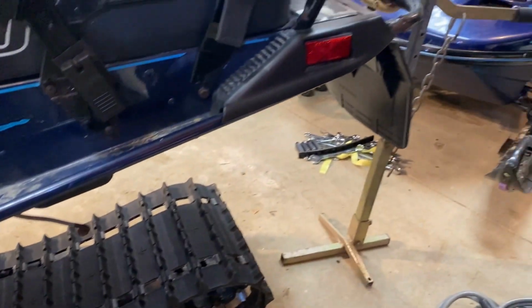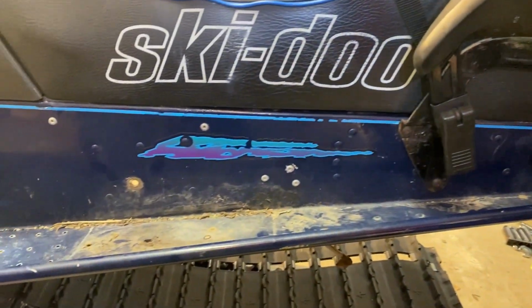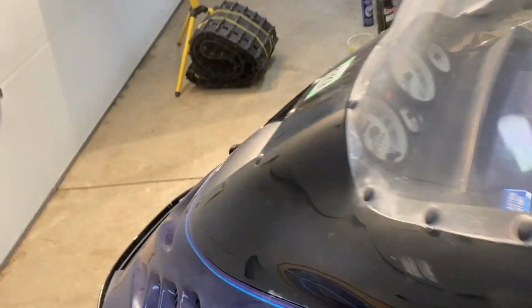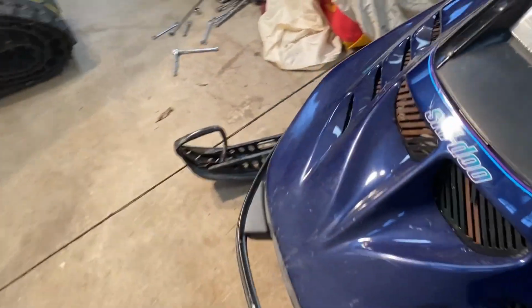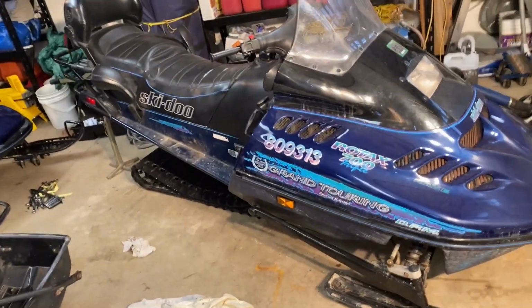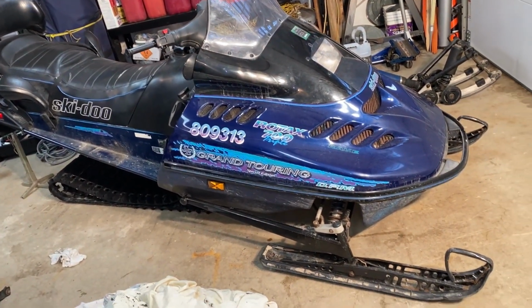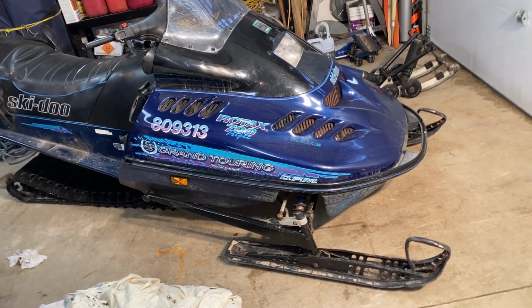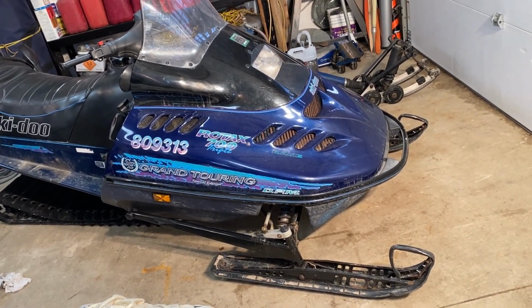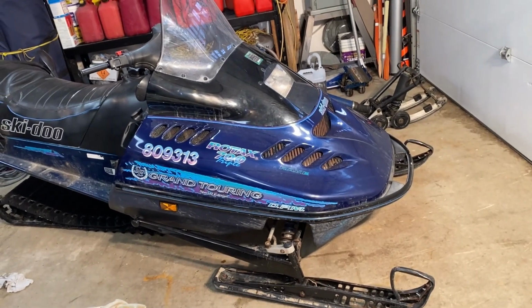It's out. I jacked up the back end after I had unbolted everything, and that allowed me to get enough play to swing the skid out from under the chassis and away from the track. So now it's just sitting suspended with nothing under it. So now I'm going to resume pulling out the Speedo, the bearing cup, and the chain case.